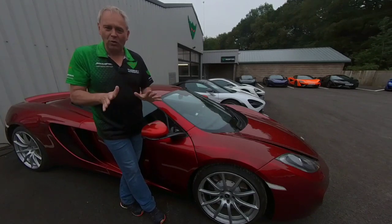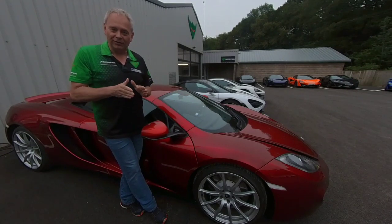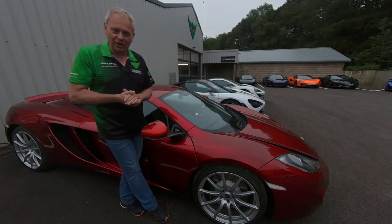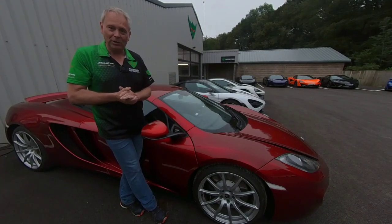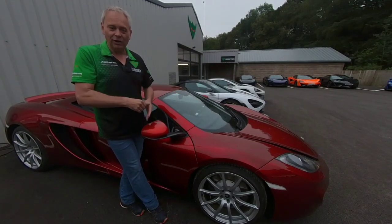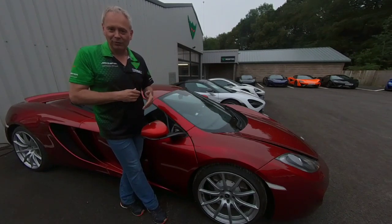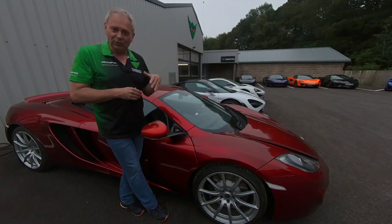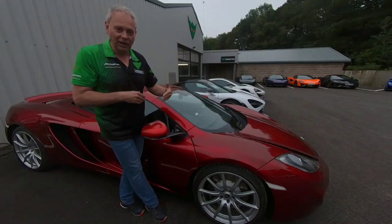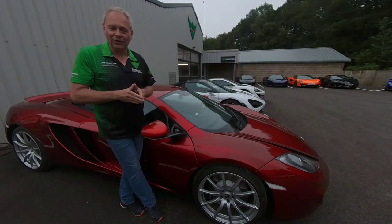On the road test — it doesn't matter what model — I did actually video the road test but it was so dull I stopped it. Most importantly, don't go thrashing someone else's car when it's cold — that's one of the major causes of top-end engine issues. Drive the car in automatic mode first, just making sure the gears go up and down smoothly. If you are going to get gearbox selector issues, they'll demonstrate more clearly in auto mode as it tries to hold a gear or gets juddery. But don't expect a fully automatic gearbox — these are manual gearboxes with an auto function, that's all.